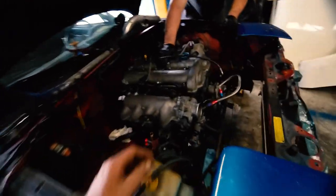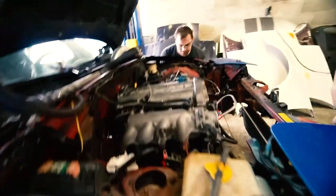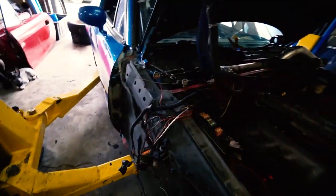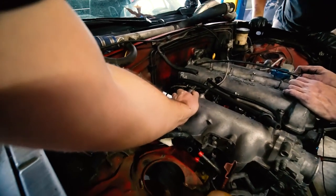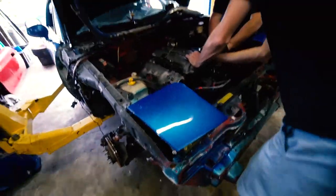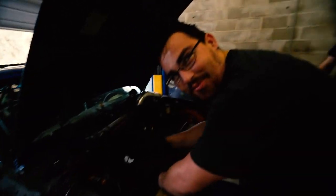Need to come towards me — it can't yet. Got to go up some more, still on the subframe studs here. It needs to go up a tad. Now try. We're hitting but try to go. You're going to hit these fuel lines. All right, go. Now we're hitting over here too. Ready to be like — I told you you had to pull the manifold off.